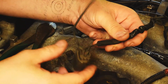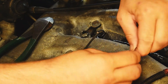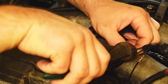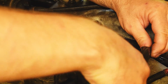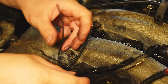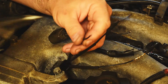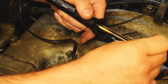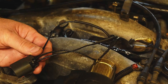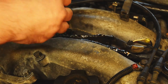After stripping and soldering those together I moved to the next one. I mistakenly cut it too close and had to peel the cover back further, which was enough to distract me. If you look close at the plastic connector, you'll see they're not oriented the same, which means I wired it backwards. Once I soldered all three, I slipped the heat shrink over and used the heat gun on them, then taped it all up — and it was ready to blow up the new ignition coil.